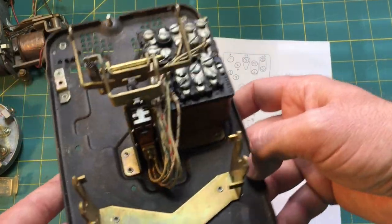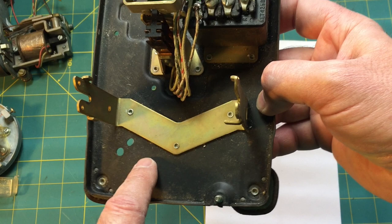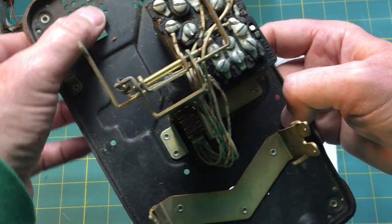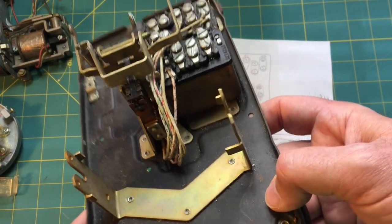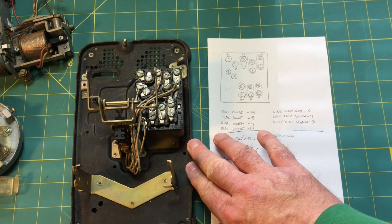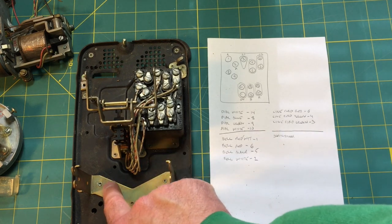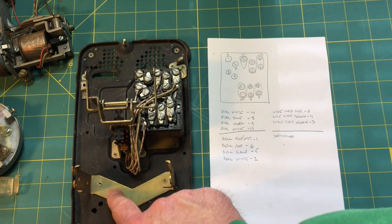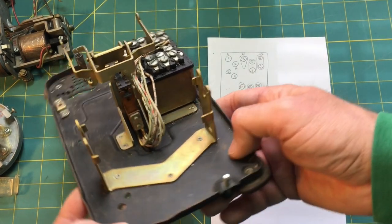For the base plate, I obviously can't throw this in soap and water — I'll end up ruining it. So I'm going to use rubbing alcohol and a brush or some swabs to clean it. It's just gritty dirt inside — you can feel it, it's all over everything, and it's probably contributing to the bad smell. The base plate, bell mechanism, and dial mechanism all still have this really bad mildewy, basement smell.